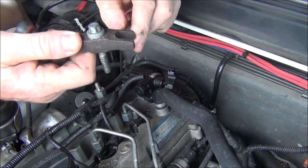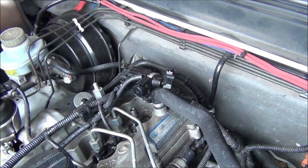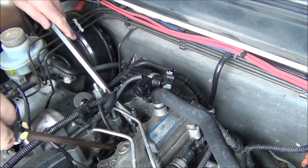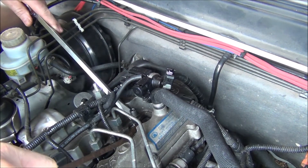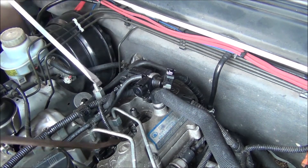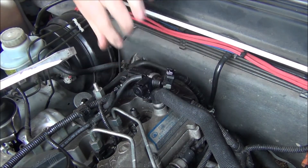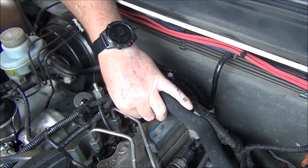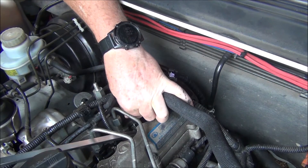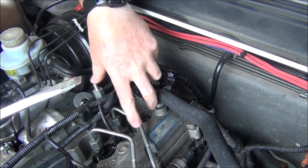That's the clamp you're looking for — the injector sits in there and gets pulled down, so that's what you've got to undo. With a bit of luck the injector should just slide out now, depends on how long it's been in there. You should be able to just lever it up and try to pull it up straight. Sometimes they get stuck and you've got to screw a slide hammer on the end to knock it out. Just make sure before you pull the injector out that you clean around the area — you don't need any debris going back into the cylinder.